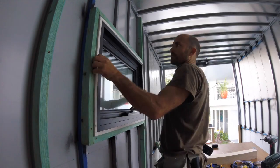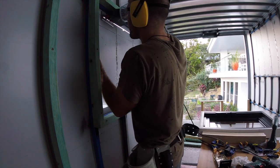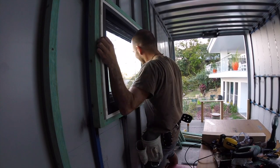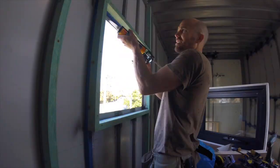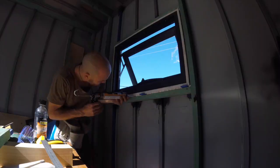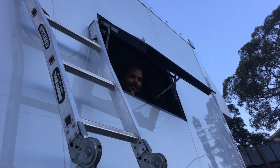He started cutting the biggest hole we have ever cut in the truck. When you've got a big hole in the side of your house for the first time, you're going to be scared. We made sure everything fit nicely — check out our view though. With a heap of Sika Flex on the inside of the aluminium, Timon set the window and fixed it to the aluminium with about a hundred roofing screws. He Sika Flexed as much of the space between the shims as possible and drove screws through the outer frame into the reveals.